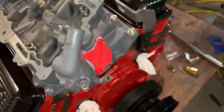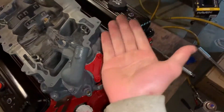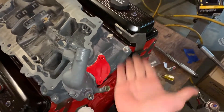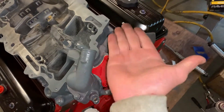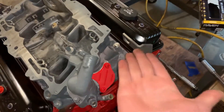Down here you have your balancer and your timing cover. You can see the notch here, and you line up your balancer with your timing cover — that tells you you're at top dead center at piston number one. However, because it's a four-cycle engine, you have your compression stroke and four cycles. You could be at top dead center at compression or also at intake — it compresses, explosion, exhaust, intake — so you're coming back up through all four cycles.